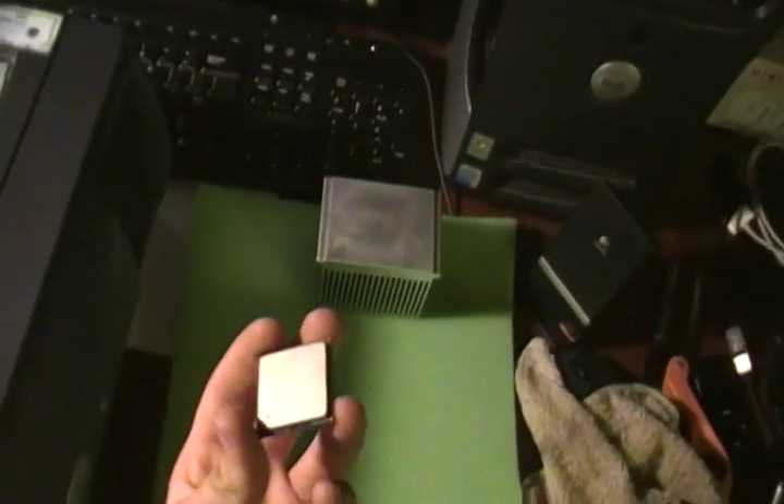You can't even see it on the camera, but this is a Pentium 4 2.2 gigahertz processor. It's got 512 kilobytes of cache, which is pretty small, and — wait, let me read this correctly — a 533 frontside bus, so not as good as I thought. Anyway, we're going to be replacing this 2.2 gigahertz with a 2.8 gigahertz, so hold on while I find it.